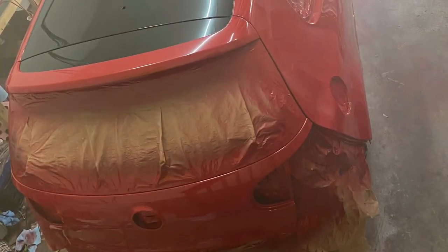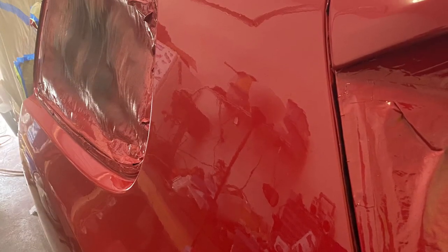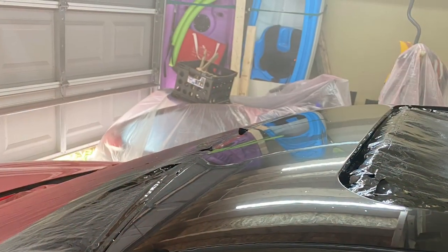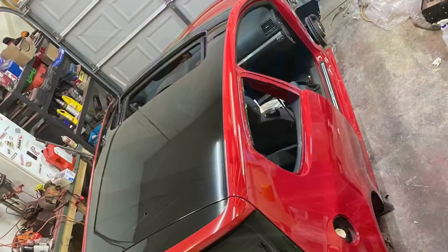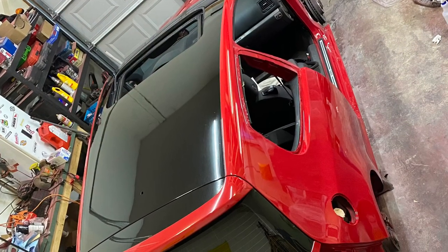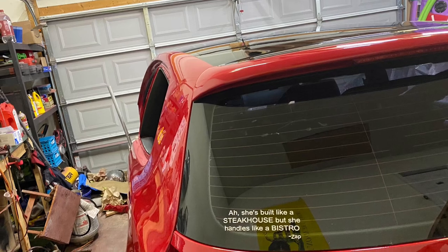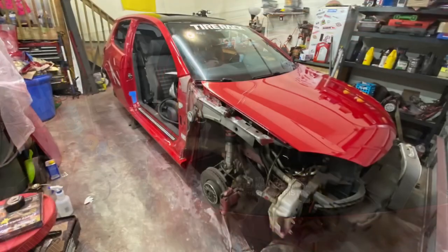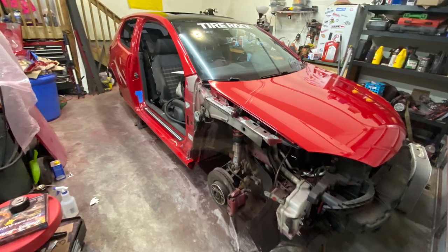Just make sure you don't have any ghosting of where that primer used to be. Once you're done with the red you can take the masking off the roof and start spraying clear coat — I just did two coats and it came out looking pretty good. There's a lot of trash in the paint just from spraying in a garage; my garage has pretty high ceilings and that for some reason makes the problem so much worse. But I can buff that out and she'll be looking smooth and shiny. Subscribe to see future progress — thank you guys for watching.